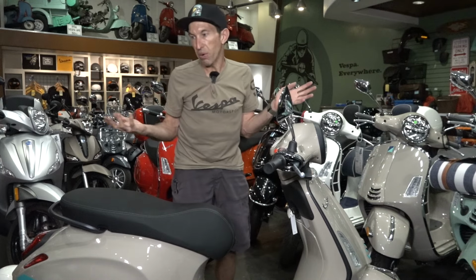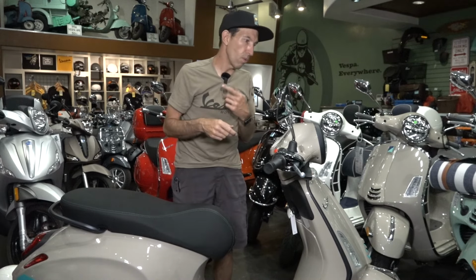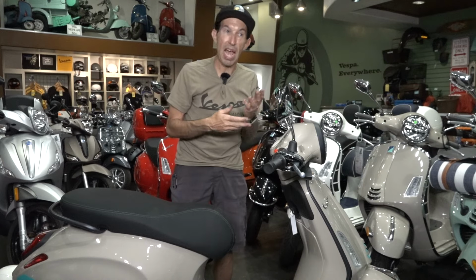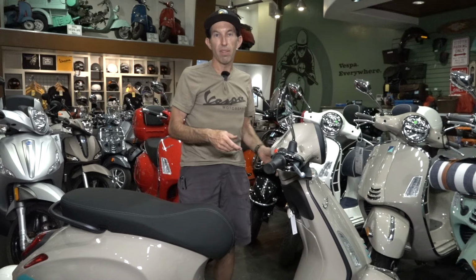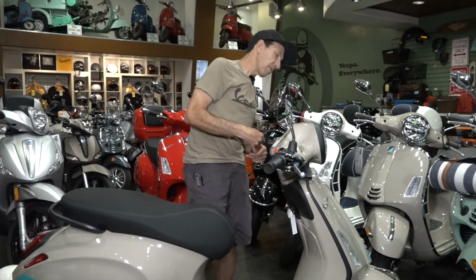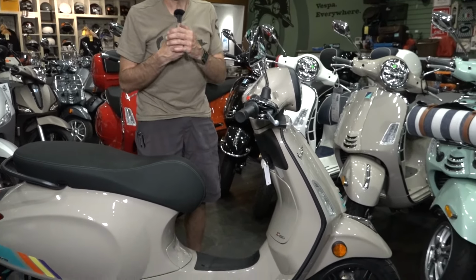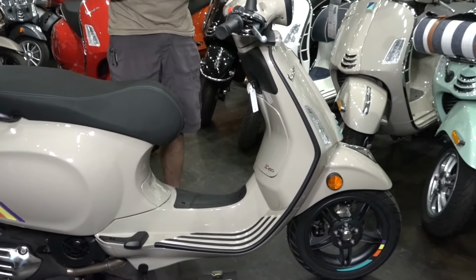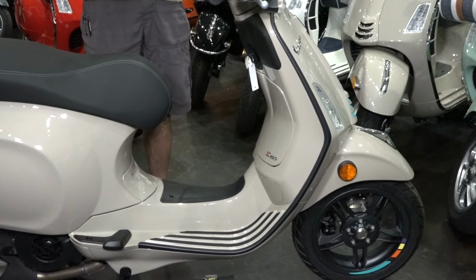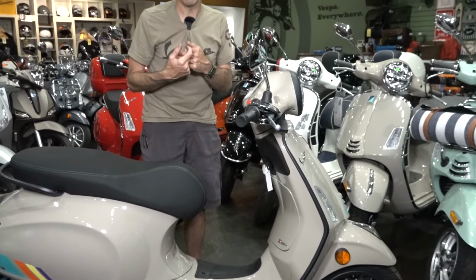It's going to be really hard to record any of those noises, but whenever you act on the front brakes, it does make kind of a clicking, whirling noise, and obviously that noise slows down as they're slowing down. The brake rotors on these scooters are vented rotors. There are drilled holes in there, and those little holes catch the brake pad material, and that's what makes that little noise versus a solid rotor that wouldn't make nearly as much noise. So that's pretty normal to hear those kinds of noises.